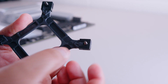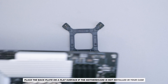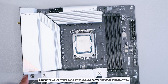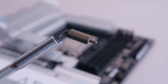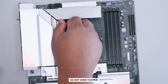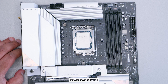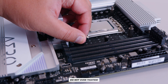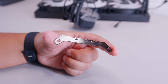First, grab the back plate and adjust the offset based on the socket you're using. Place it on a flat surface if the motherboard is outside your case, then lower the motherboard onto the back plate. Locate four of the bolts and finger-tighten them into place. Do not over-tighten, as they will be very hard to remove later. Finger-tighten all four until they're in place.